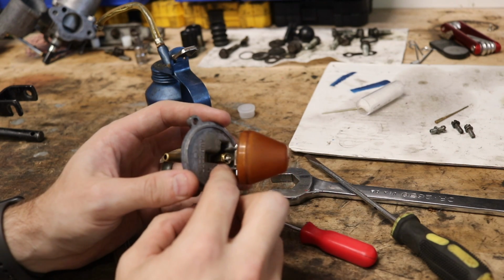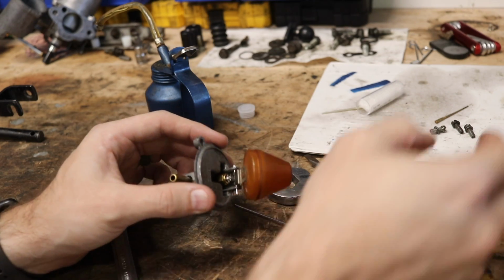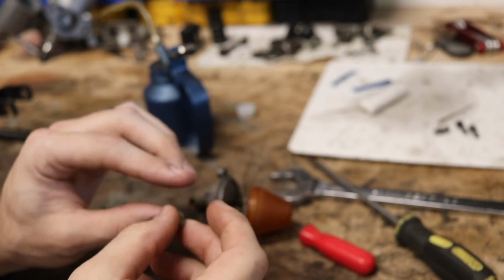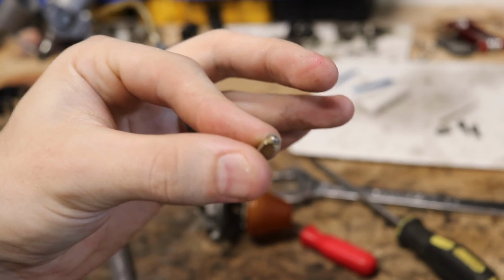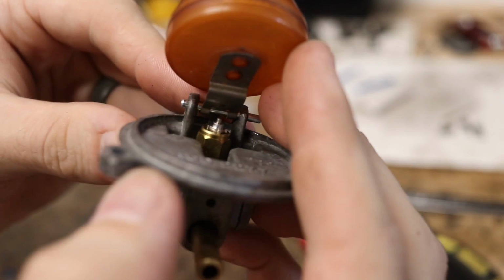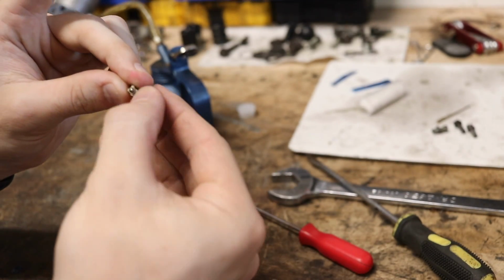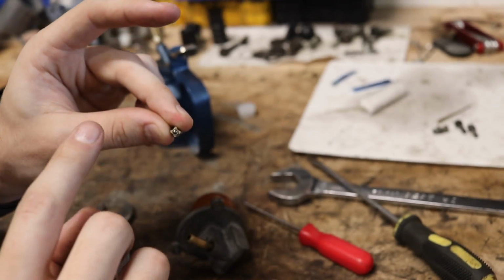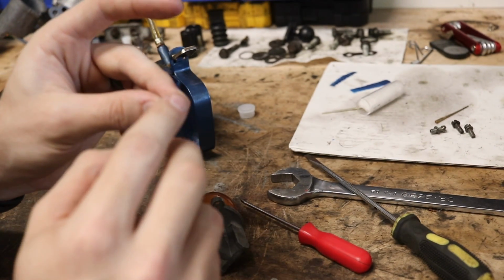But one thing that I was told in my last episode is that for these little fuel regulator thingamabobbers, there is a better version, which is what was on the car already. This here has a small little ball valve on the end of that. The one that's inside the float bowl right now has a little piston thingy in there. And apparently this ball valve is widely regarded as the more efficient version because you always get a clean surface for that valve to get pressed onto.